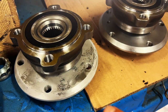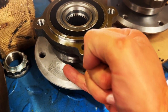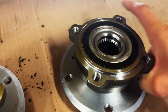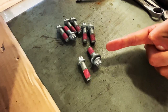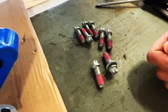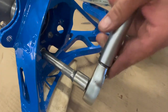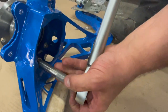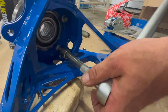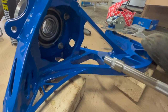For the assembly of the hubs and wheel bearings, a good trick is to put the hub into the freezer so it shrinks a little bit — leave it overnight and then it goes into the wheel bearing very easily, and you end up with a unit like that. One important thing: you need to remove the washers from the bolts that come with the wheel bearings because otherwise they don't fit into the assembly — there's not enough room. We make the piece as strong as possible, so remove those washers. The bolts that come with the wheel bearings always need to be replaced when you take them out, and you set them to 110 Newton meters or 81 foot-pounds in a crisscross pattern so it sits nicely.